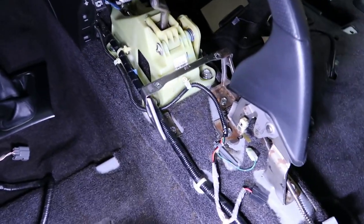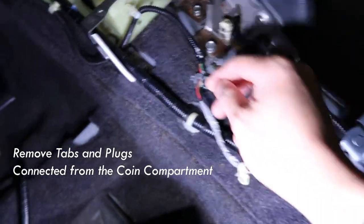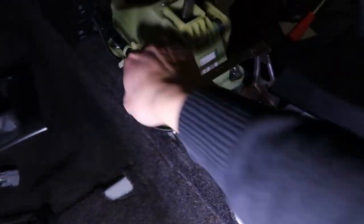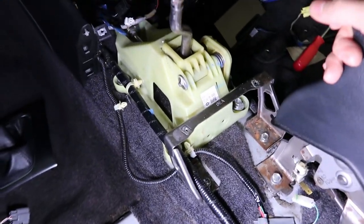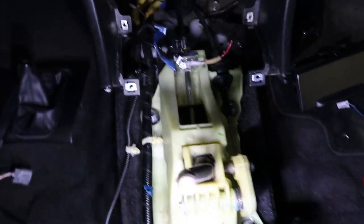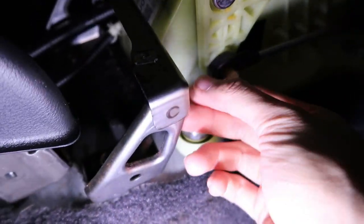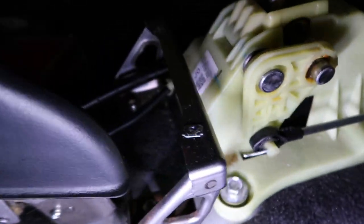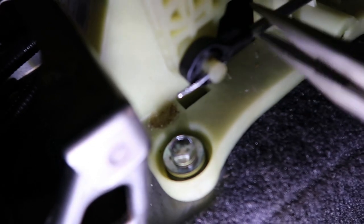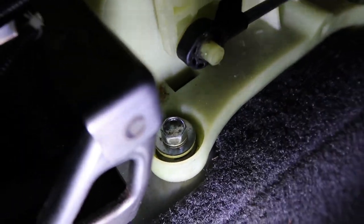Now that it's taken apart, there are some tabs attached to the center console that you need to remove, along with this plug. Go into the shifter and pinch the two sides so the tab comes out. If you do break them, an easy fix is to just cable tie them together. Now for basically the hardest part — the cotter pin right here that you need to remove. I've gone ahead and made it flat for you guys so it's easier to understand. That pin locks in the shifter cable, so just remove it so it comes out, and then you can remove this section.